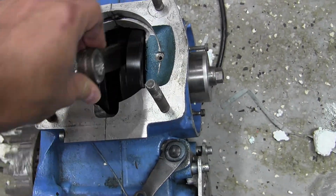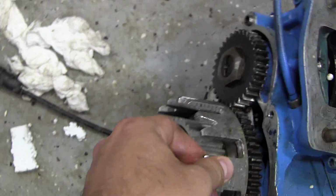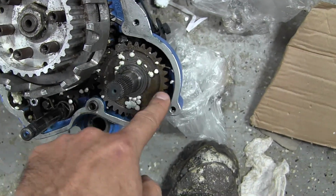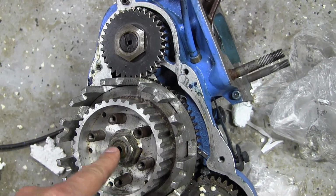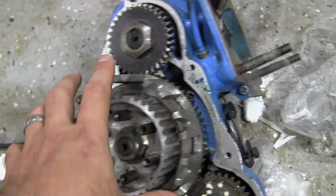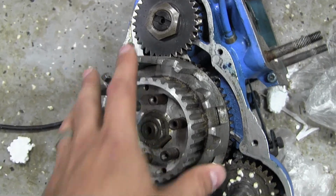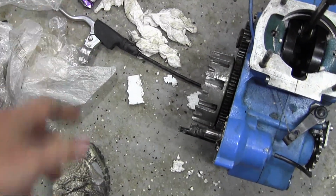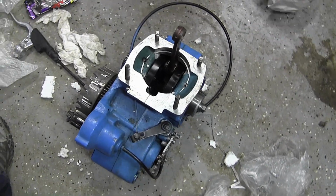It doesn't have all of the stuff, I don't have the whole thing for it. It's a little rusted, some of it. You know, the clutch basket. Yeah, there's some wear. I'd have to take apart the gears and see how this engine is, it turns over though. But as you can see here, the difference from the 500 is it does have 6 clutch bolts versus 5. This is a thicker clutch basket too. I don't have the side case for this. I don't have the top end for this clutch thing. So I am missing some parts to get it running. I need a side case and I need the rest of the clutch for that. But this is a Maico 685 bottom end.